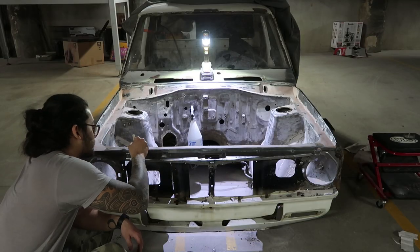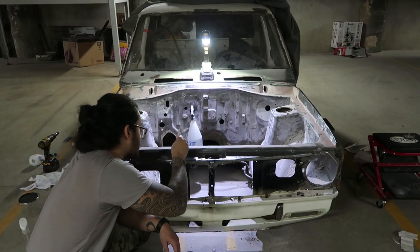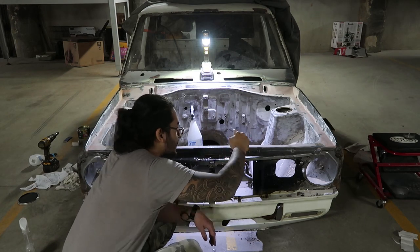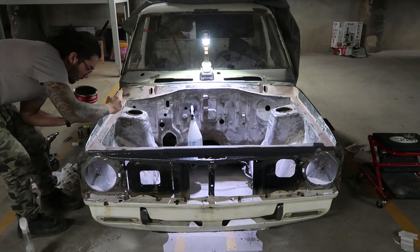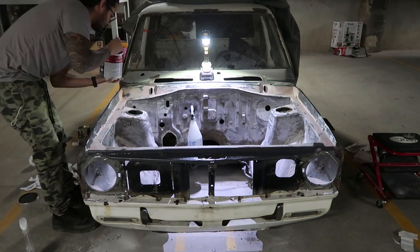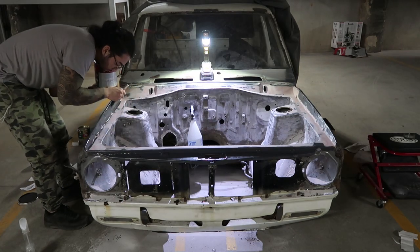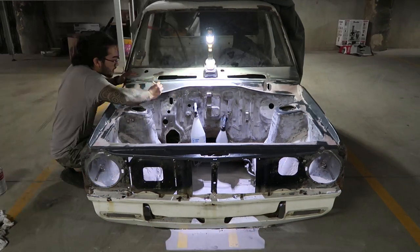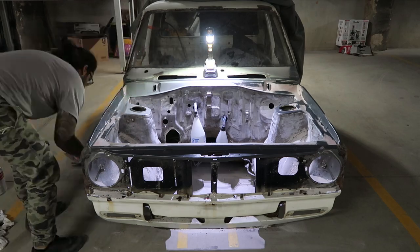Now that I'm mostly done on the rim of the engine bay, I'll seal the bare metal with some etch primer and then some filler primer on top of that. Once the whole area is done, I'll go over with more coats of primer and then with a finer grit of sandpaper to work out any of the deeper scratches and get rid of my brush strokes. The final base and clear coat will be going on with air in the future.